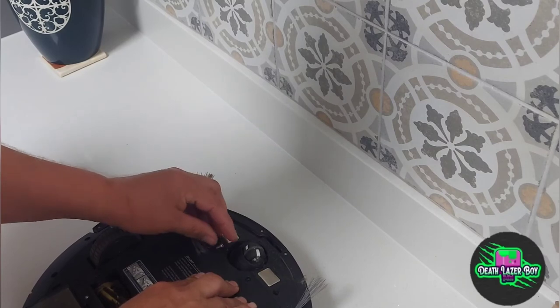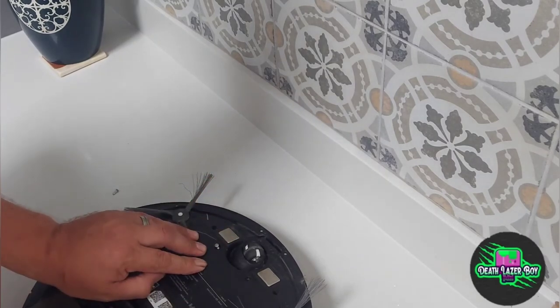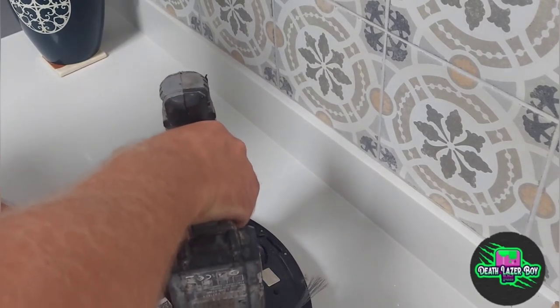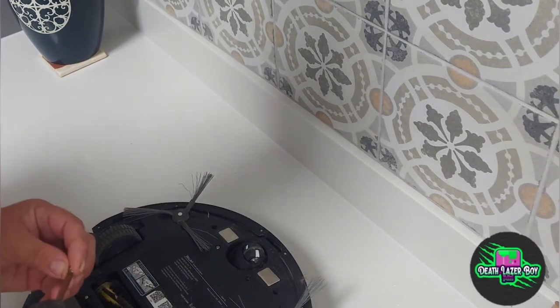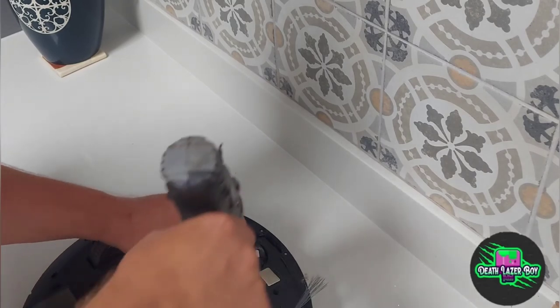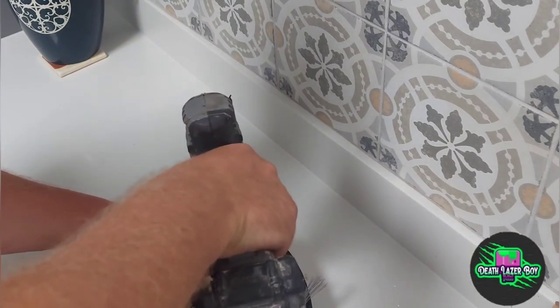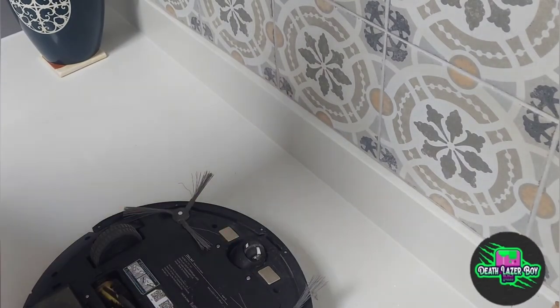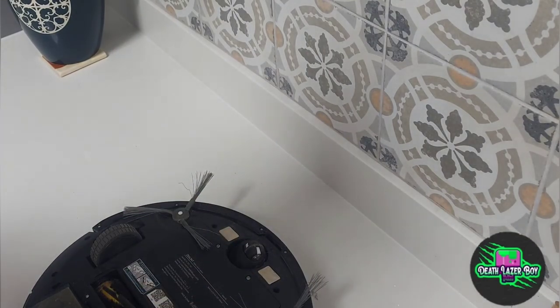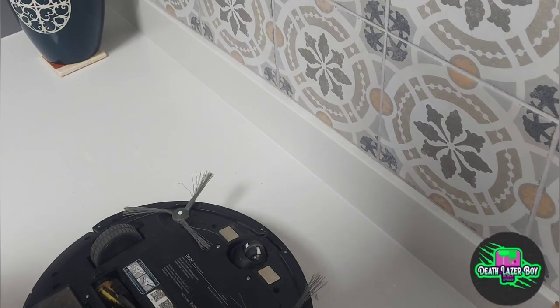Put the screws back in, and then we'll stick it on charge and give it a full charge. And hopefully that's fixed the problem where it turns off halfway through cleaning, as the voltage drops too low. I think that this happens quite quickly, because if it happened slowly, then it would realise it was running out of power and then go back and dock itself.